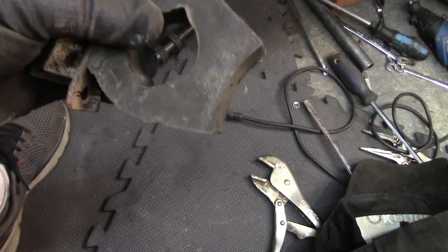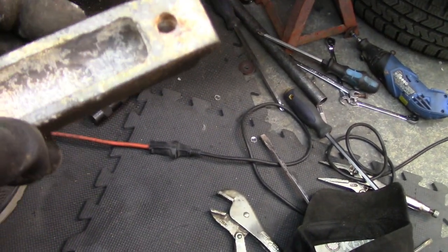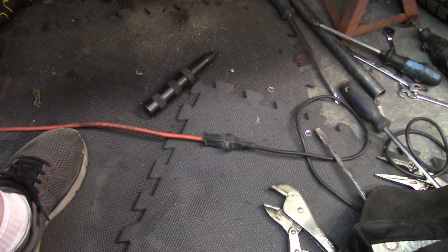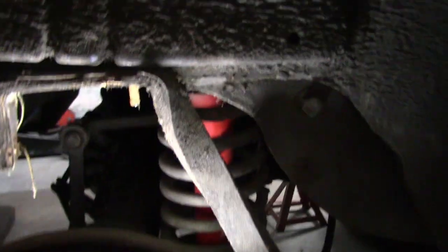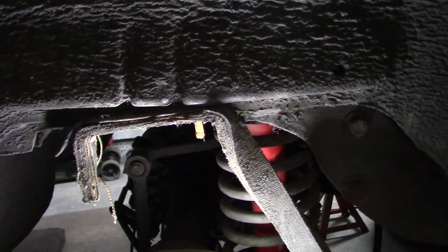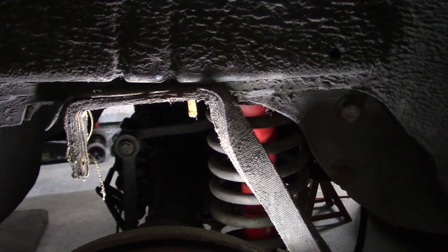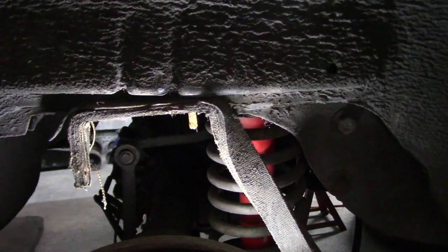We've got the buffer and the mounting piece. I think this might be aluminum or pot metal — kind of a poor design from Alfa Romeo. That clearly was going to be rusted in there and problematic. We've gotten the head of the bolt off. I'm now hoping to grab that with a pair of vice grips and get it out. The last thing I want to do is break that bolt off and have to drill it out — it's kind of a tough place to get to. I'm hoping that bolt is going to turn out now with vice grips.